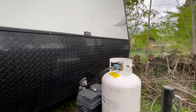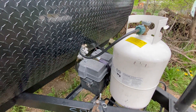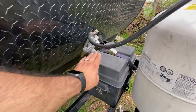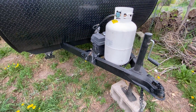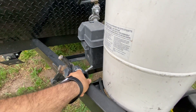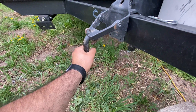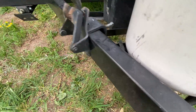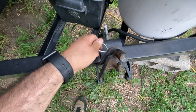Right here we have the hitch. This is a manual crank, 30-pound propane tank, which does come full. The battery is in here, and these are the weight distribution hooks — essentially where the chain hooks on. There's a little tool I provide you with: as you lift up, the chain goes here, you lift with the tool until it's in place, then put the clip through right here, and you're ready to tow.